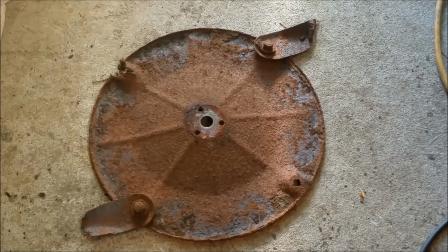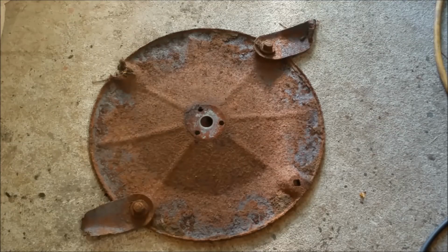There's no doubt in my mind whatsoever that was going to be a good running engine the way it was. We needed to sort out the spark issue, which again is points, and the compression was a little bit down, but it wasn't too far down. It was actually quite respectable. I'm sure it would have raised itself a little bit when the engine was warm and it sort of righted itself. It hasn't been running an awfully long time by the look of it. But somebody put a new plug in and thought that that would help start it. And of course, the problem was, by the look of it, the points.